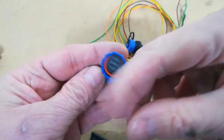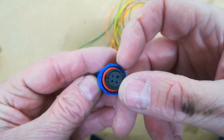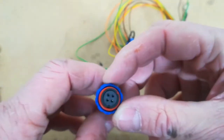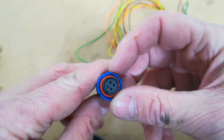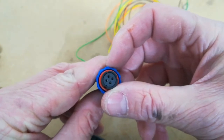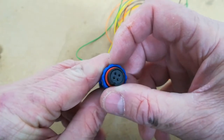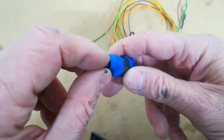What I use is these connectors — this is the four-pin variant. You can get a two-pin and also five or six pin. You only need a two-pin for the CR-Z because the fan is driven in a different way — we just stick the fan over the outlet for the IMA venting system. So all we need is two pins to get power into the battery.